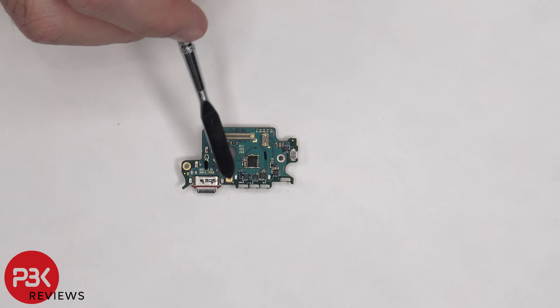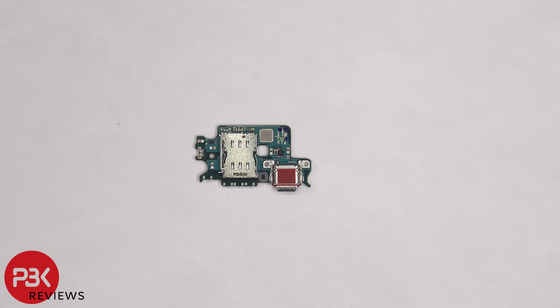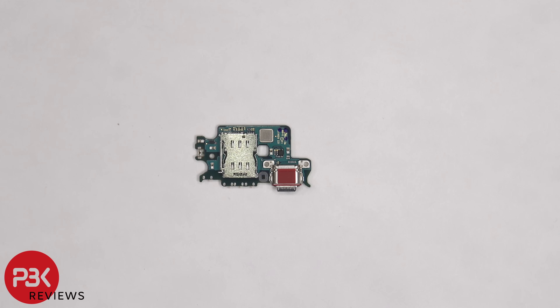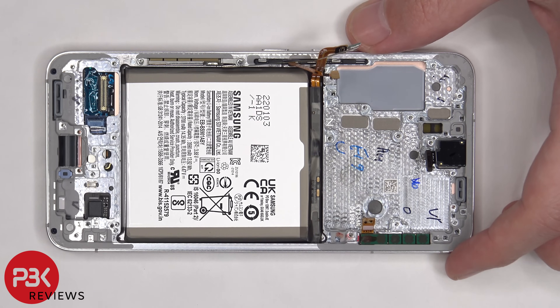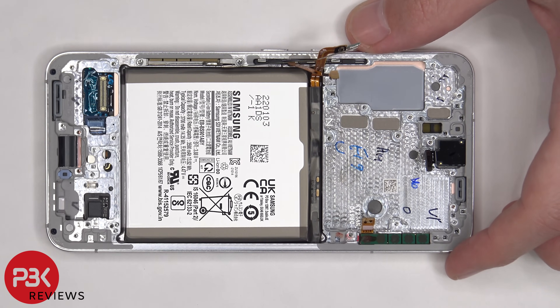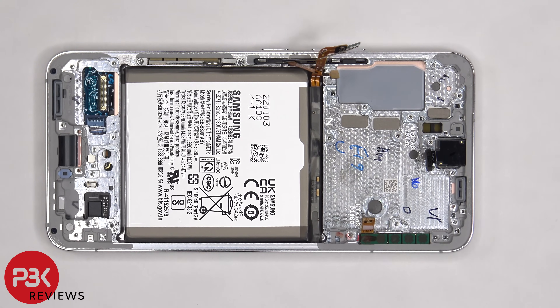The primary microphone is located in the center, and the SIM reader is located on the back. There's also a rubber gasket around the charger port. Now that the subboard has been removed, we can see a liquid damage indicator — this white sticker on the bottom. The color remains white, indicating no liquid got inside the phone. So during the durability test when we dropped this phone in water, none of the water got inside.